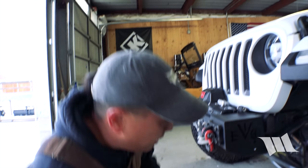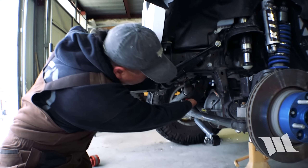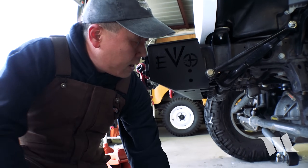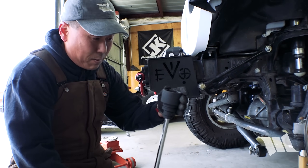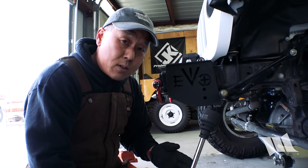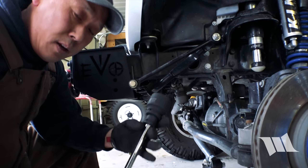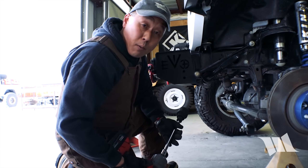Alright, now that we've got the tire out of the way, the next step is to remove the pitman arm nut that you can see right here. This is actually securing the pitman arm to the sector shaft of your steering box. In order to do that, you're going to need a 42mm socket — it's a really big socket and you can pick one up at Amazon; I'll include a link in the description. It won't be something you'll have in a standard toolbox. You might want to use an extension if you're using an impact wrench; otherwise, a breaker bar will get it done too.